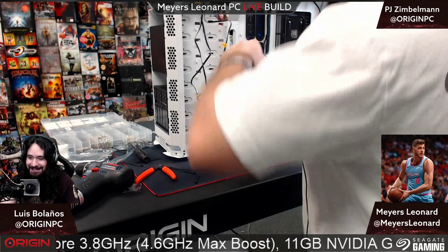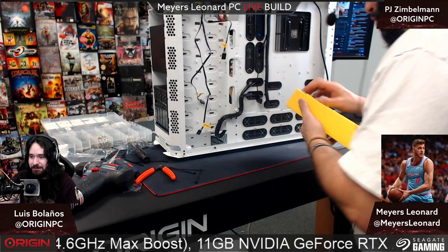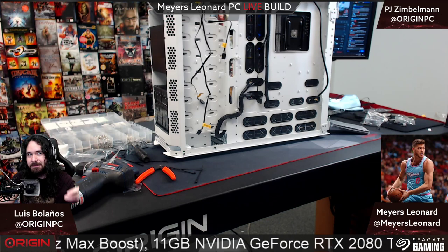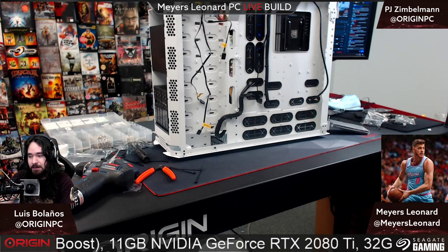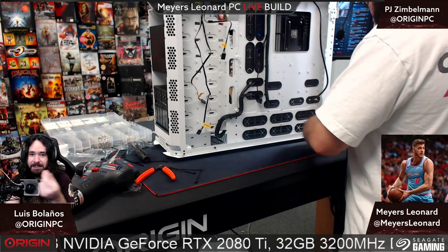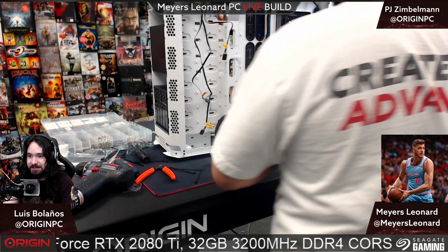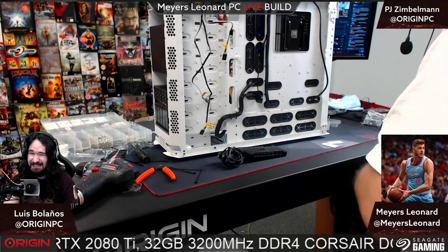Are NVMe SSDs themselves, or are they just to go in between? So NVMe is... I think I've explained it before. It's the interface in which the data on the actual M.2 drive interacts with the motherboard and the CPU. So it's that interface, right? M.2 is the form factor. So the M.2 SSD is that size, but the NVMe is the actual interface that allows it to interact with your PC. So hopefully that explains that. And then you have, of course, the PCIe, which is the literal hardware itself. Hopefully that explains that, but there's more technical information online. Hopefully I tried. I did it for you.